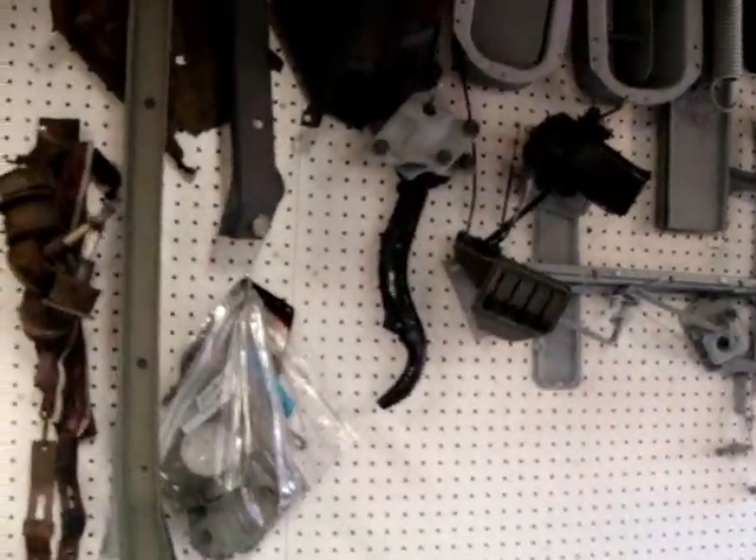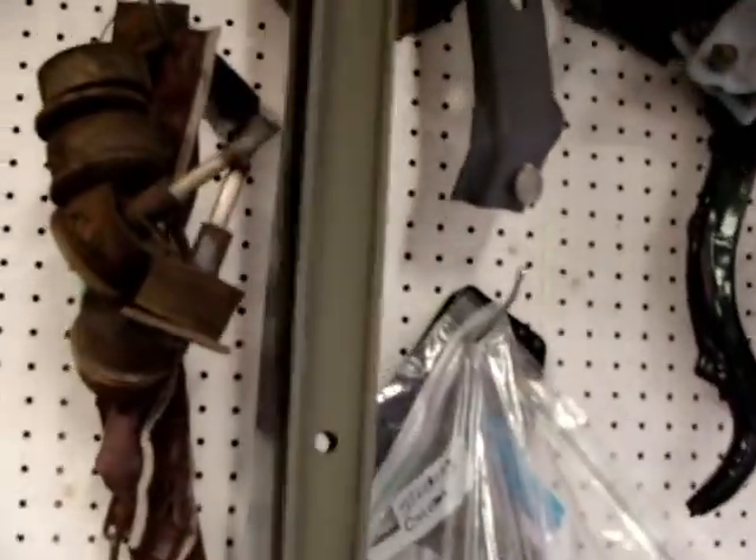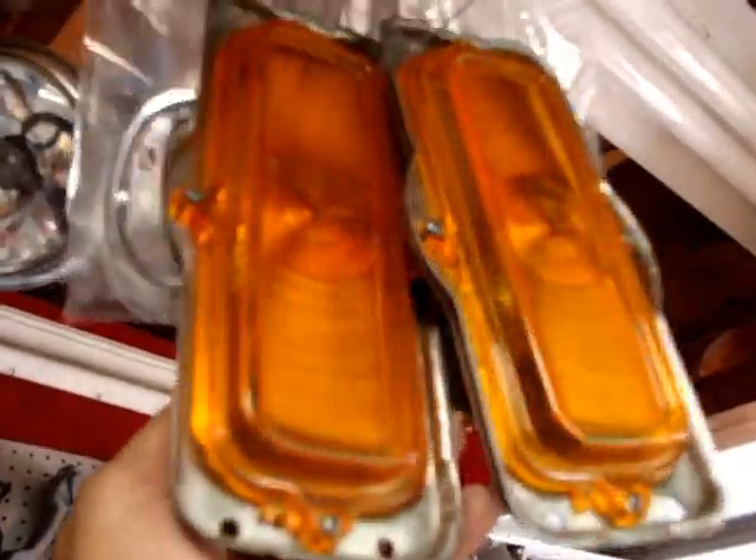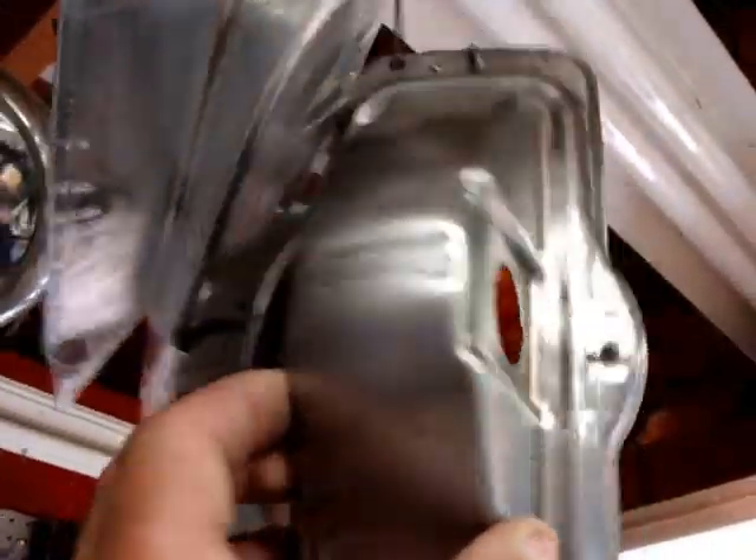What I've been doing for the last couple of months is working on all these parts — sanding them down, sandblasting, painting. Well, I got primer on there — a self-etching primer on all my parts. Cleaned up quite a few of them, got them ready. Bagged some of the parts up. As soon as I get my inner rockers and outer rockers in, I'm going to start on them first so I can get everything lined up.